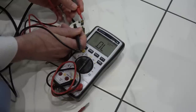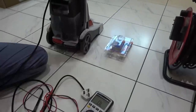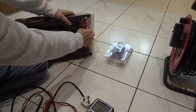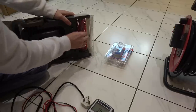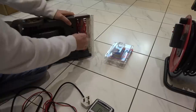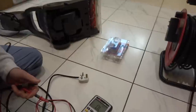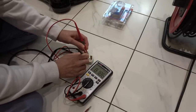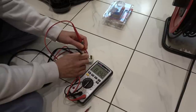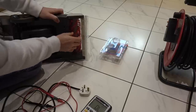You're going to want to see it tripping. Nine ohms - I wonder, is the motor jammed? I feel uncomfortable plugging that in. Well, it suddenly freed itself up! It made a noise and then freed itself up. Let's see now if we've still got that reading. Imagine if it was just a motor that was a bit seized. 81 ohms - interesting, it's certainly higher because it was 11 before. I wonder if the motor was seized.